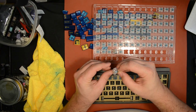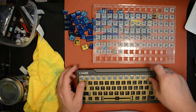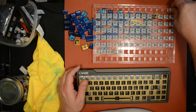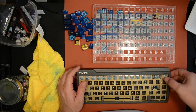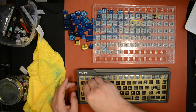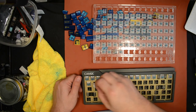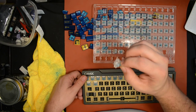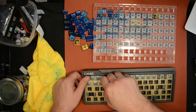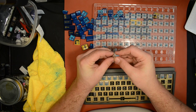And if you're careful enough, by the end, all the switches will work. But in my experience, usually you miss a couple. Usually you have to pull one or two switches back out and straighten the pin. But usually they're salvageable. I have had switches where the pin got bent more than once, and after being bent a few times, it broke. Then that switch housing was done. There's another one with a bent pin.